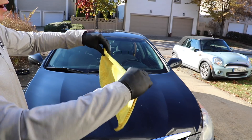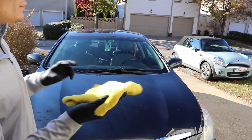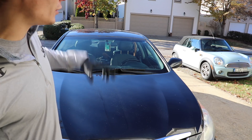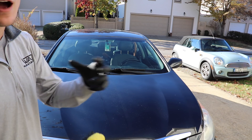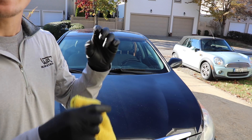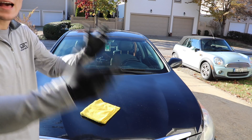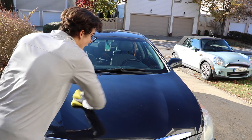After I've gone ahead and removed the product, I'm going to flip to a dry side — you can use two different microfiber towels if you want. I'm going to buff off any remainder of the product to get that shine, because it does come with glossing agents. For example, Optimum No Rinse comes with a wax element. You want a dry microfiber to bring that out to maximum capacity, so I'm just going to buff it off just like I would a wax.